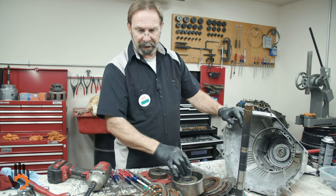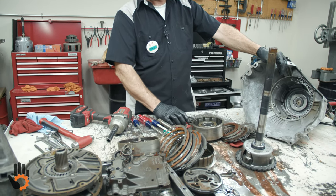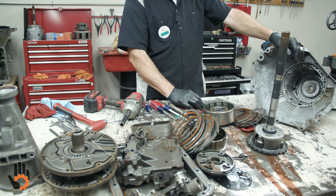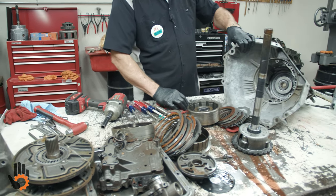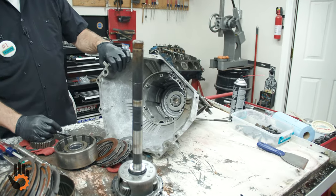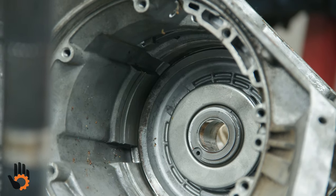And pretty much it. Valve bodies on these things were pretty simple, pretty straightforward. The pump itself, like I said, we can do an inspection video on that, and then also show you how to get the springs compressed in the back of the case for that piston, get that removed so we can properly wash the case itself.